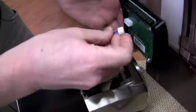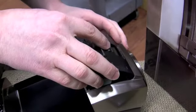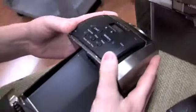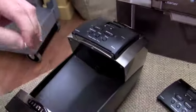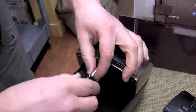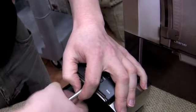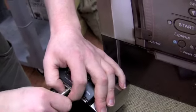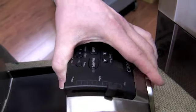Installation is the reverse of removal. Wire goes in, slide the top in first, and the bottom will just press down — it won't actually click, just press it down and once it's all the way down, it's down. No calibration needed with the tabs, because there are little sliders on the side that they'll meet with, so there's only one way they'll go in. Just find the slider in there, line the tab up, and click it right in. Same thing on the other side.